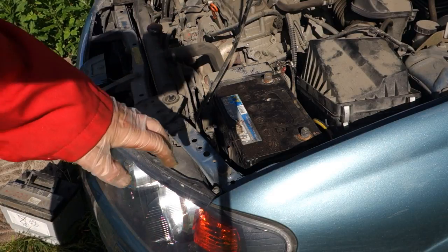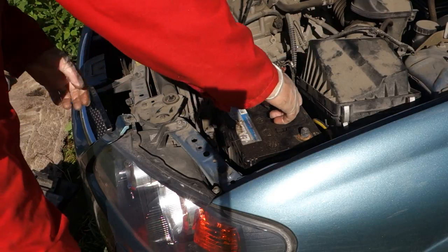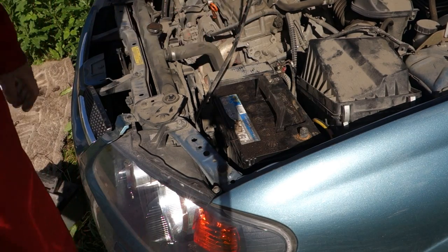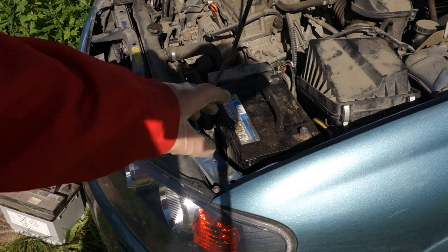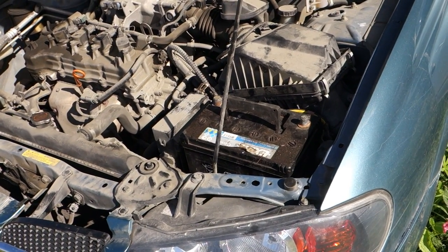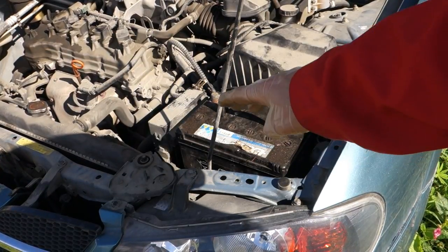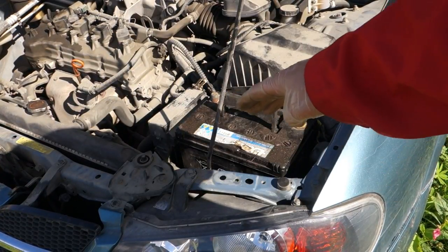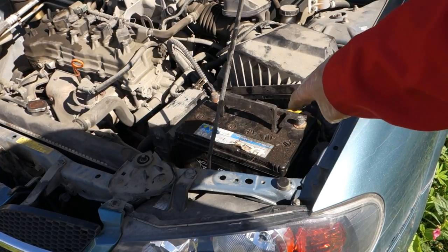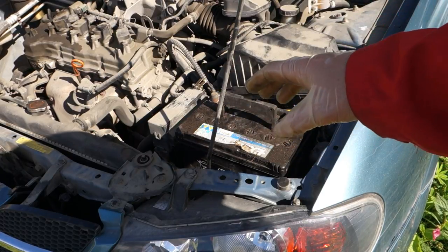And lifting happens so that I insert my hands in both sides and I lift. Or then if there is this lifting hook, I can lift that in this way. And then remember, these batteries are heavy. They are heavy, and there is also the possibility, remember this risk, that there is some bad corrosive liquid, this acid, in the outer area, so use gloves and wash your hands.